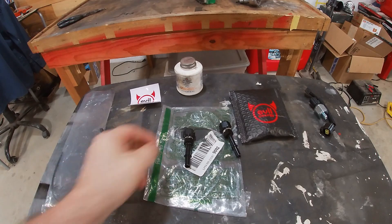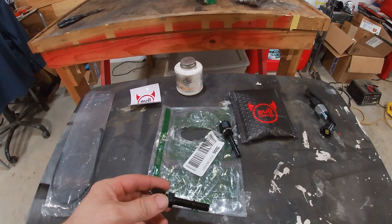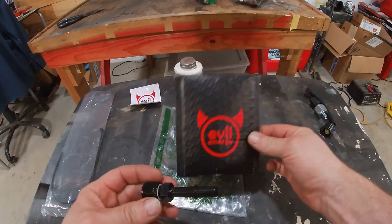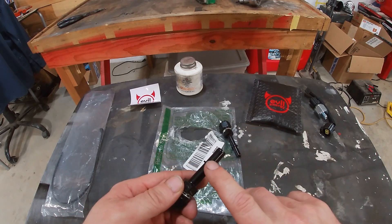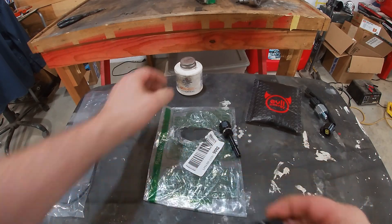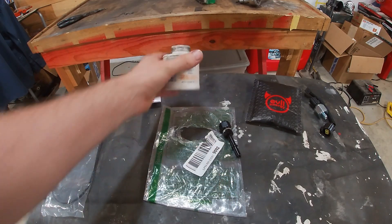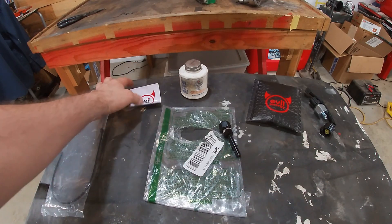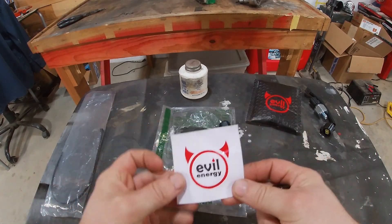I've got some parts to finish up the fuel system — somewhat better parts. So this is the Evil Energy quick disconnect to an AN fitting — I got that from Amazon, they probably have a store or something. And then I just got the AN cap on there, and for a little extra protection to make sure it stays on, I got the thread sealant. So that's kind of one of those spots you don't want to leak right there. I even got a sticker decal — whatever you want to call it.